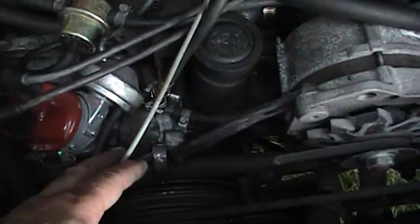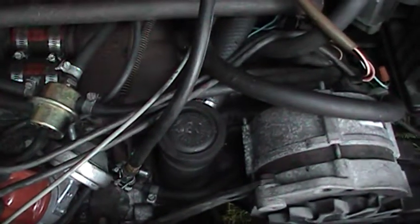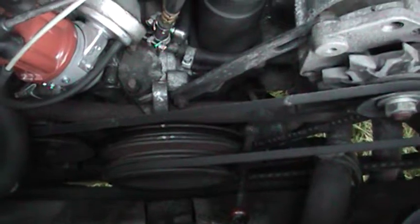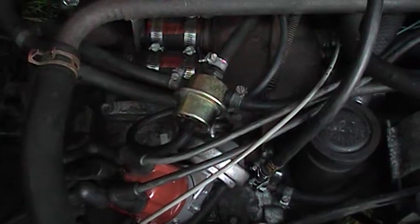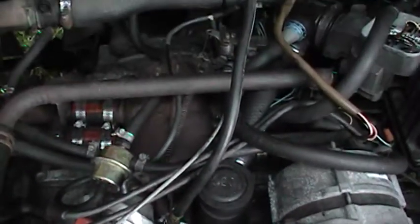Could not even keep it going with the vac advance — with the retard plugged into this one, which is a very low vacuum at idle. That would tell me that the retard wasn't... that it was retarded more when it was plumbed in here than when it was plumbed in there. But for some reason I couldn't even keep it going. So I'm going to put it back to how it was originally plumbed into the fuel pressure regulator, continue to keep that one capped, and see what happens.